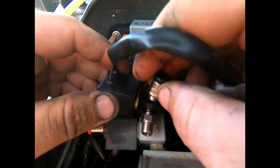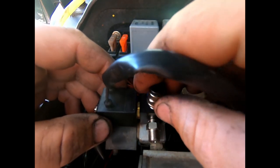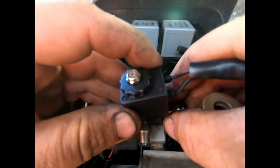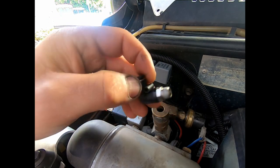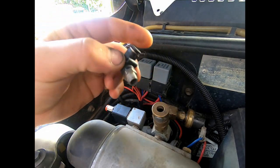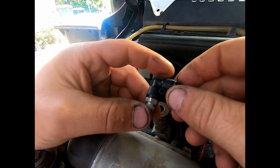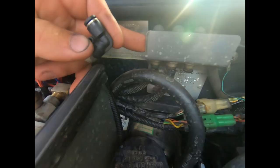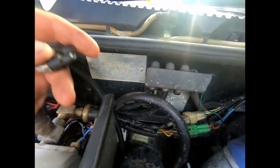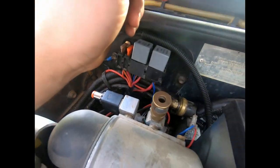The kit that the locker came in doesn't have an elbow. So this is either gonna have to face up for now and I get an elbow or... So I had a search through the shed and I found a 90, it's a 6mm 90. So I'll put that on now. I'm not sure if this can take pressure though. I'm thinking it came with the diff breather kit, because it's the same fitting as those anyway, plus it's a 6mm hose, so I'll put it on and just see how it goes.